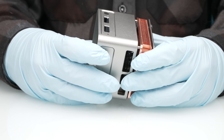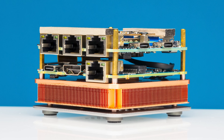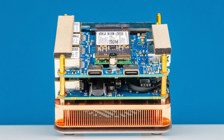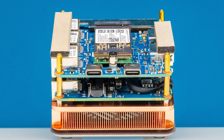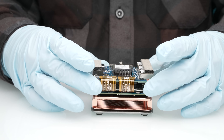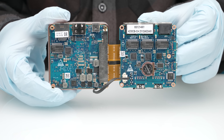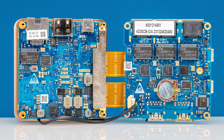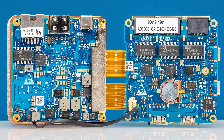The chassis comes apart pretty easily and what you see is a sandwich of two different PCBs. The top PCB controls things like our three NICs, USB ports, and the NVMe/PCIe lanes going to the NVMe drive, Wi-Fi, and all that — it's basically become an IO PCB. As part of the sandwich, two ribbon cables go between the top and bottom boards. The bottom PCB is where a lot of the magic happens — that's where the processor, memory, and power input are. One thing they changed in this generation is how the cables connect: they now have little covers so they're more securely seated, and I think that's a nice design improvement.